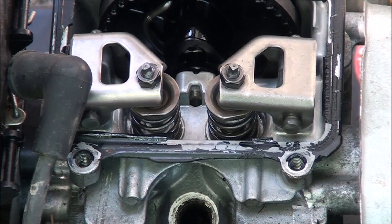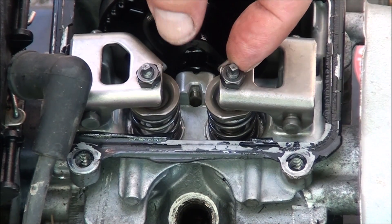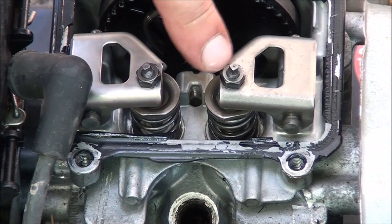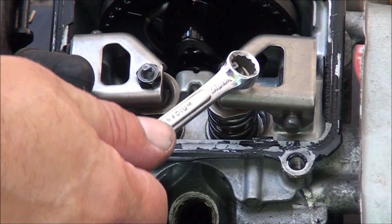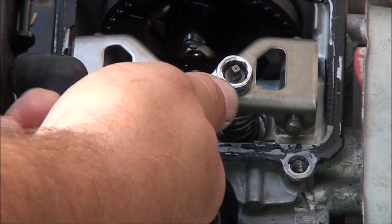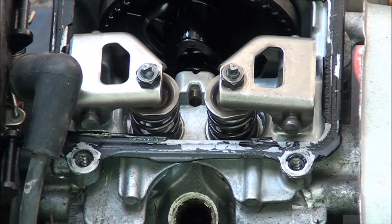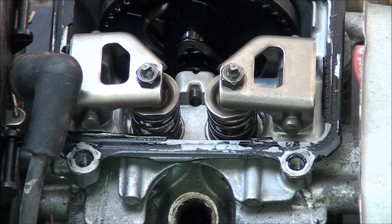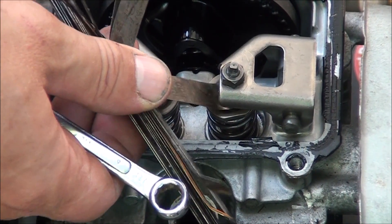Go ahead and tighten it up. To do that, you'll want to loosen up the lock nut and then turn the adjustment screw clockwise. Hold it with a pair of pliers — that's about what you need to do since I don't have the special tool. Then lock down the lock nut. I'm not too worried about torque specifications — I'm just not going to over-torque it, but you don't want to under-torque it either. Just make it tight. It's a 9mm here to loosen that. You can actually turn this with your finger. I've got my 8 thousandths and I'm just going to tighten it until it's a little stiff to get in and out of there.